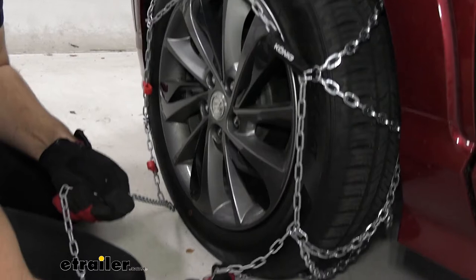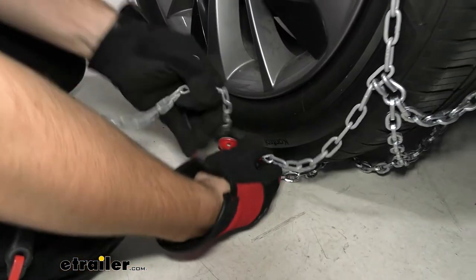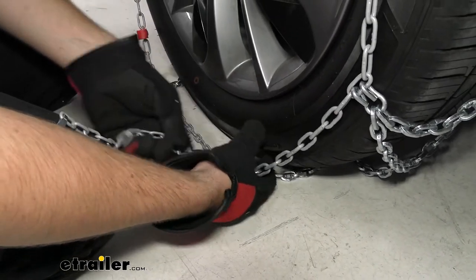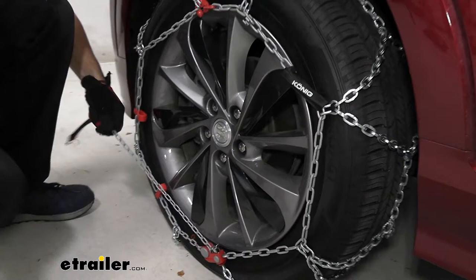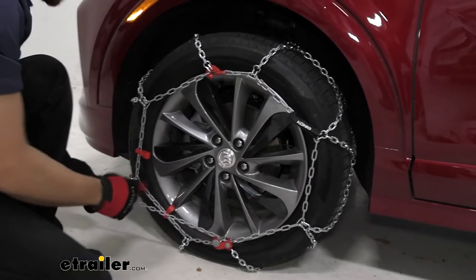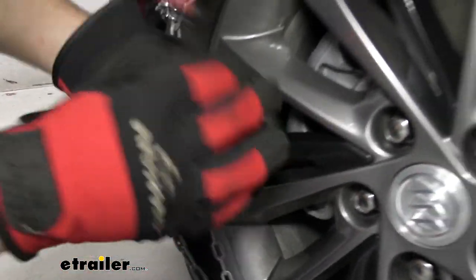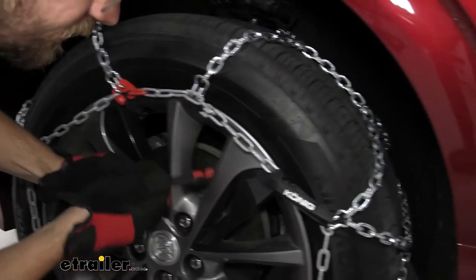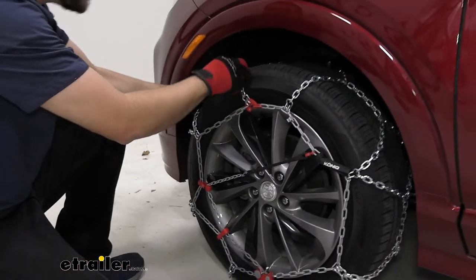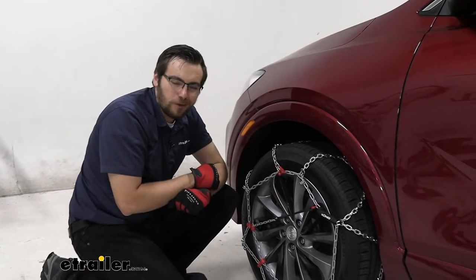We need to make our front connection first. To do that, I simply take my two ends and bring them together — just like that, we have it nice and secured. Now we take our tensioner at the bottom with the pulley system. We have a little lever we need to pull — simply push that back like that, let that chain sit just like so. You can let that lever come down as well. Now I can go ahead and start tensioning this. I like to stand up, really give it a pull, try to take out as much slack as you can, letting that latch go back in place. Then we bring our tensioner through both of these red clips, and now we go to the other side of our tire to give us that tension we're looking for. Just like that, we're nice and secure — we're nice and tight, good fit, and nicely installed.